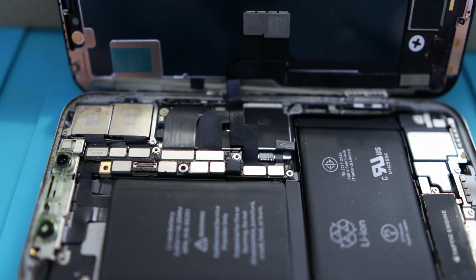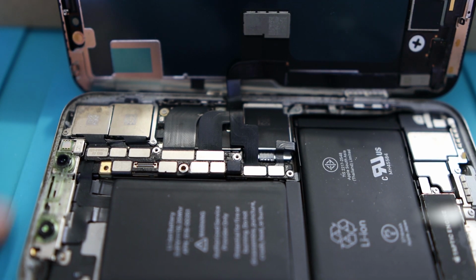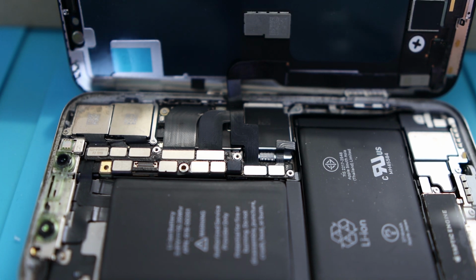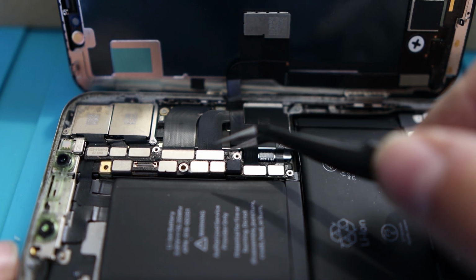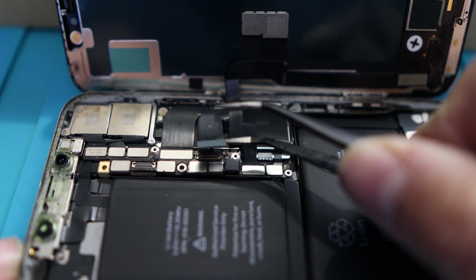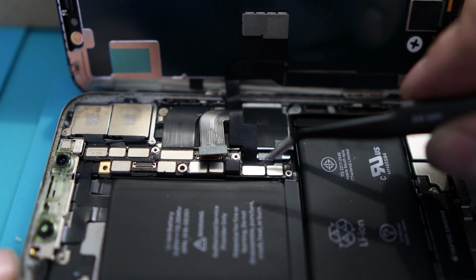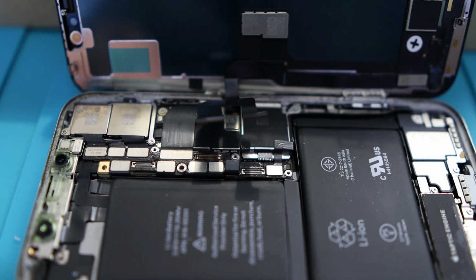By disconnecting the battery first, you will prevent any of the modules with their internal safeties, like the speaker module, from basically saying, "Oh, somebody's trying to hack the phone. We're going to self-destruct," because Apple does that. So make sure you disconnect the battery first, and then go through and gently pry up these connectors for the screen.